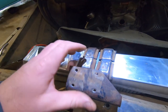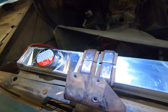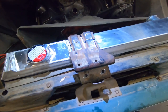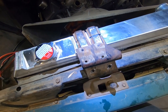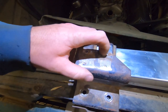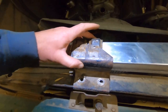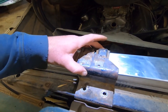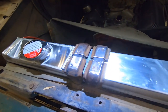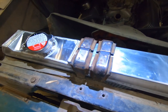I look for some material, and that's going to be tough to cut a little strip like that and not burn it all apart. I really don't want to do any TIG welding on this thing because it's not worth it. So, wish me luck. One more quick note. Instead of burning that rubber, I don't know if you can see it, but I slid this in place and took the old Milwaukee Markall black marker and marked where all my holes are at. We'll go weld her up on the bench because I think welding with that rubber might get a little intense.